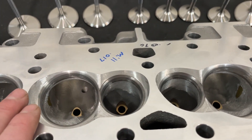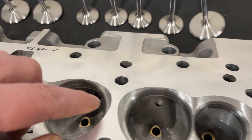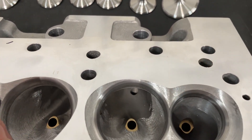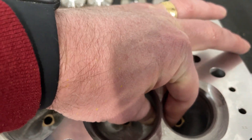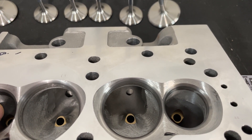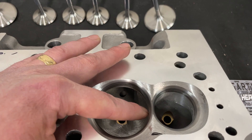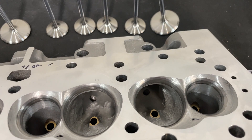So how did it do? In case you're wondering how much bigger it went — just a few percent. A couple of notes in case you tried doing this on your own: I recommend you not do it on your own because you really need to know what you're doing, otherwise you're going to screw this head up. There's not much material here. So even though it looks like a lot was removed, it's really very very little, because there's just not a lot of material between the two. If you go hogging it out heavy, worst case you'll have a crack through here. Not good. Be aware.